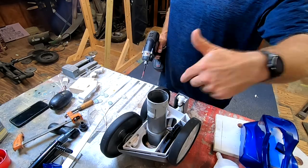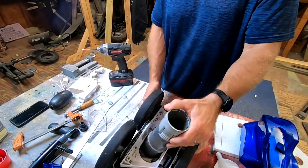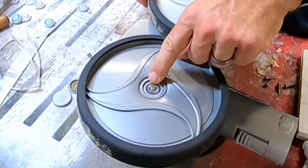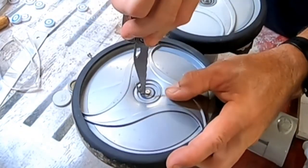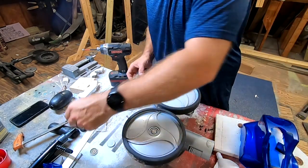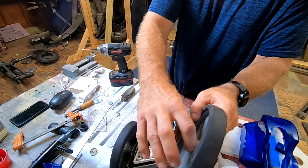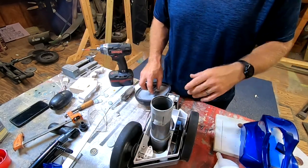Let's go ahead and get the wheels off and then we can get the whole case off. To get these wheels off you have to take these little caps off — you can see I've already replaced one wheel, different color. Pull the caps off and then there are these little C-clips you have to get off. You can use a screwdriver or a knife, pull them right out. Put them inside your little cap so you do not lose them. Now we have a tire — it comes with rubber on the outside and also has the bearing attached to the gear.